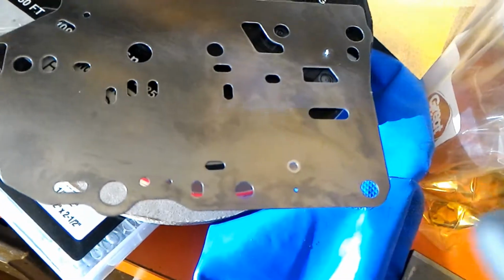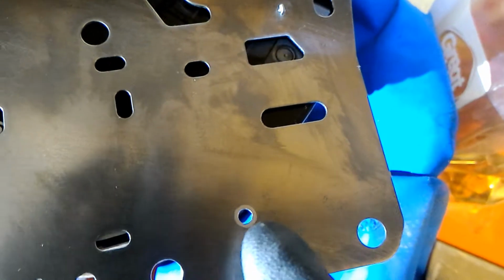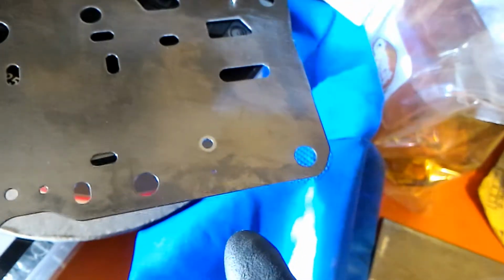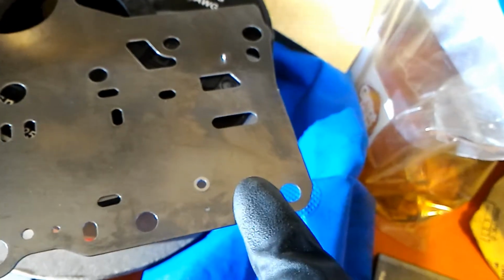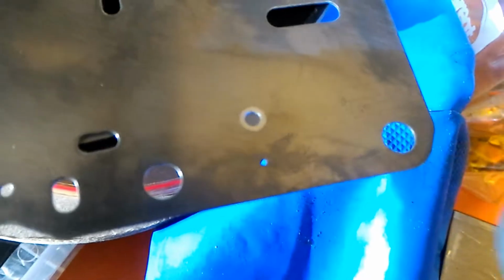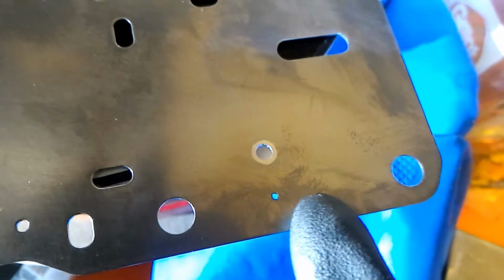Right, so I'm finished with this, and you can see here it's 0.125 inch, so it's fairly flush. It's not perfectly flush, but I'm kind of lazy, so I sanded it with coarse grit, and then I finished it with 800 grit, and I drilled that hole too using the smallest bit there. It looks really clean. I drilled it here, then I drilled it from the bottom, and then I sanded everything after I drilled everything.